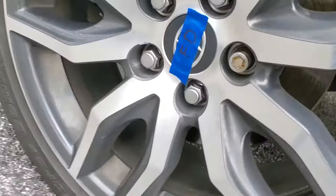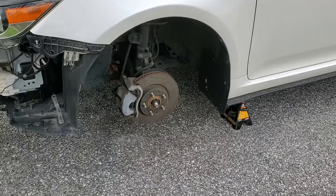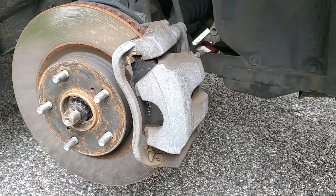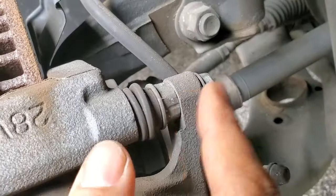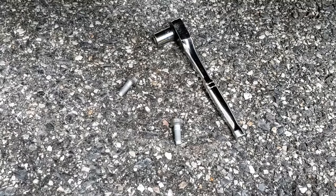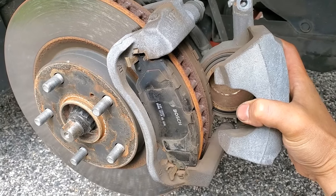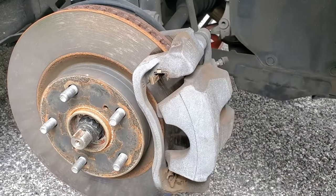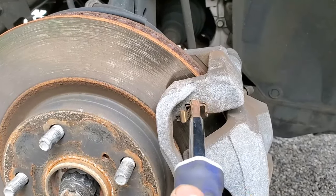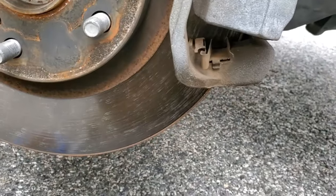Now we can take the lug nuts and wheels off. I've labeled which wheel goes on which corner of the car because I'm going to be putting them in the basement while the paint dries. Starting with the front caliper, remove the top and bottom bolt with a 14-millimeter socket wrench. Once you get the bolts out, you can lift the caliper off — just don't let it hang from the brake hose — then remove the outside brake pad and leave the inside one in place. Replace the top bolt and label your brake pad so you know where it goes. Then use a flat head to pop out the brake clips on top and bottom.